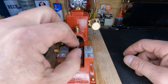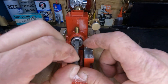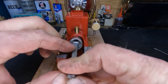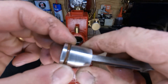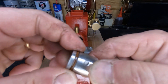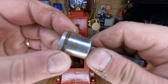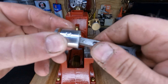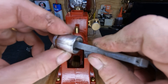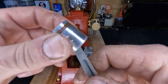Now let's get hold of our piston. We're going to pull it all the way through the back side and get a look at it. As you can see, we just have a rubber o-ring - I don't even believe this is that fluorogel material, this looks like Viton. Our wrist pin is captured, so that's a good thing.